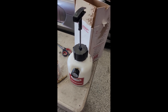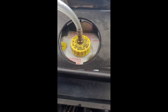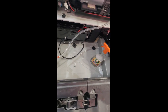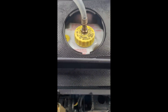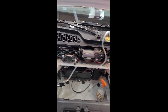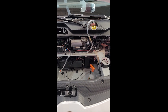I had planned to use my power bleeder but found out that this cap does not really seal very well, even though I made my own fitting and a new gasket for it. So what I did is hook up to my air compressor and set the regulator to 5 psi. The air is leaking out but it should give enough pressure to the system that I can push fluid out of each caliper pretty easily, so we'll just leave this air hooked up and running while I bleed out all the calipers.